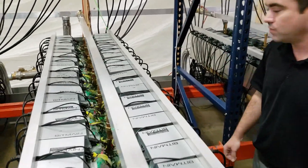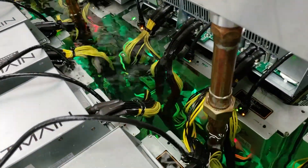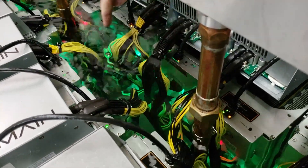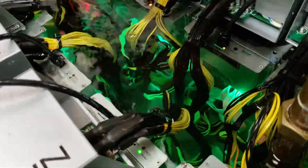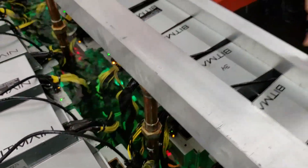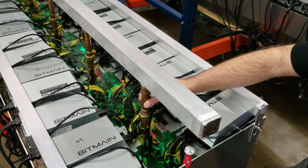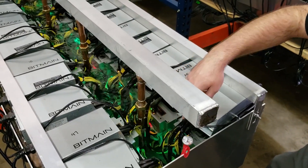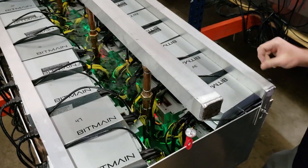Come take a look at the tank. This is our flagship model — it's a 42-miner ASIC tank. In here you can see this is Bitcool that we use to come up through the miners and then exits the sides in a fluid recovery chamber. What you see here is what we call the secondary manifold, and these pipes actually go down into a plate that separates the bottom channel from the top channel, forcing the fluid back up through the miners.